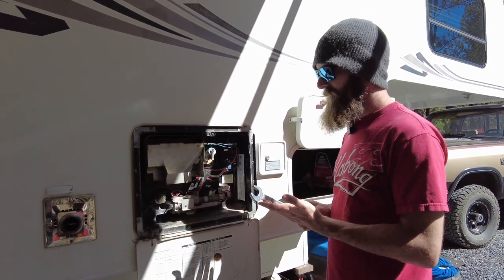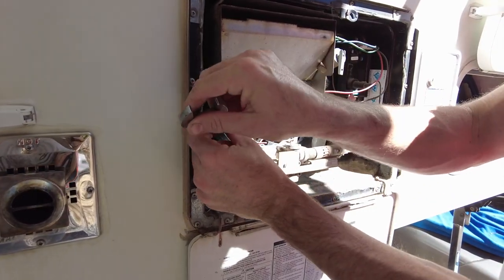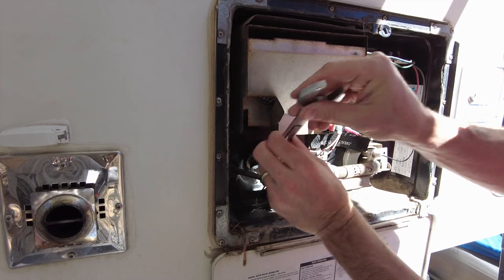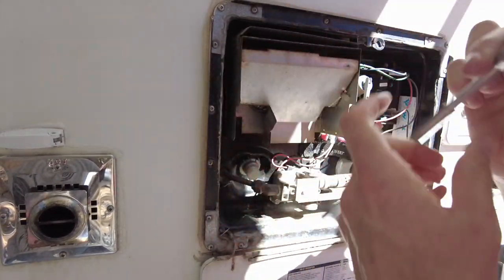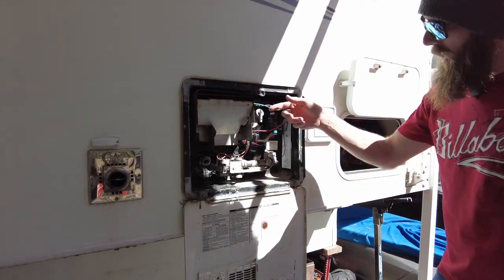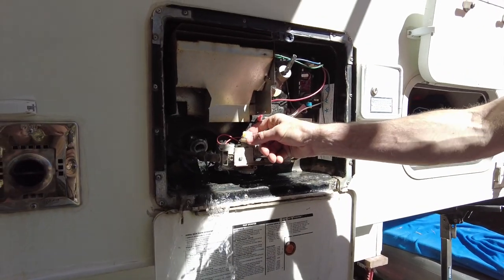This here is your drain plug and this is your pressure relief valve. In our case this is a 15/16 plug, so we're going to go ahead and take that off and let the water completely drain out. Be very careful not to snag any wires or bend the propane tube. It does take a while so just be patient. Remember that this plug is plastic, so it's delicate — especially on an older RV. If you happen to break this plug, they're available on Amazon and are pretty easy to replace.